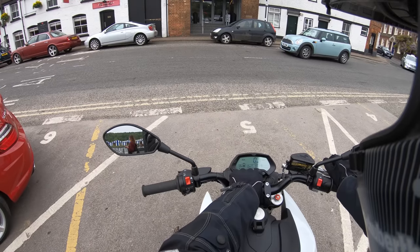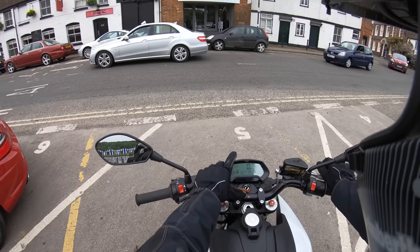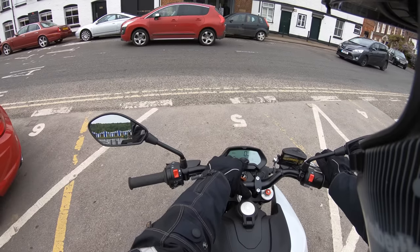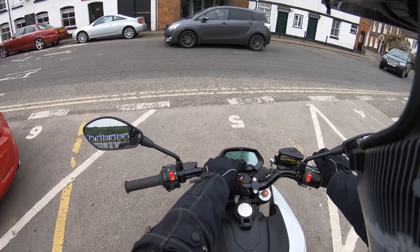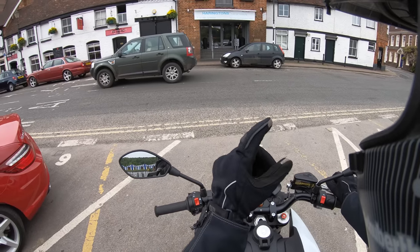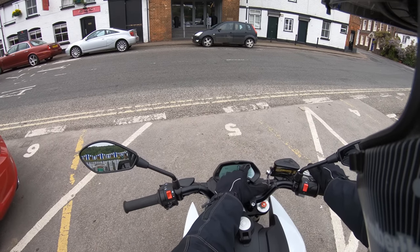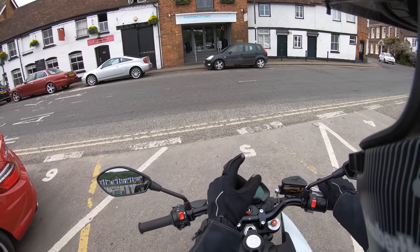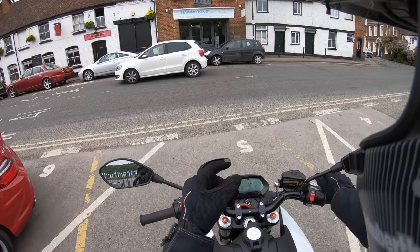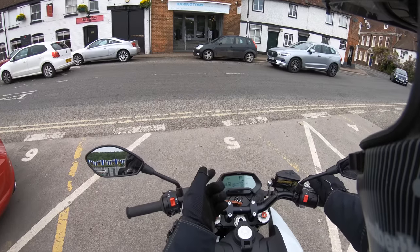Town, and we've covered 35.7 miles. The battery is at 56%. Range is giving me 45.4 miles. The first 23 miles were on motorway, and I was taking it easy, not doing more than 60 miles an hour. It was in eco mode, and it freaked me out at one point because I needed acceleration, but it wouldn't go above 70 miles an hour. So I presume in eco mode, it doesn't give you more than 70 miles an hour.